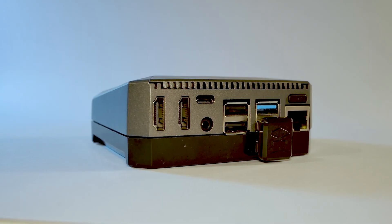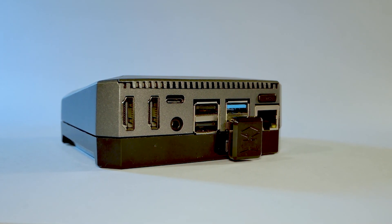If you decide in favor of the M.2 module instead of the entire case, you're going to be missing out on a couple of features. First of all, full-size HDMI ports at the back. Argon1 M.2 comes with two HDMI ports at regular size, unlike the mini HDMI on the original Argon1, so if you really wanted traditional HDMI cables, you'd probably have to get the Argon1 M.2 instead.